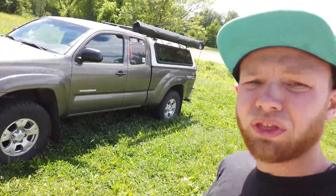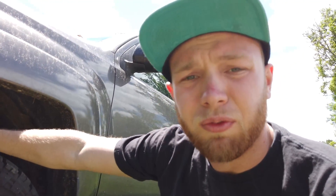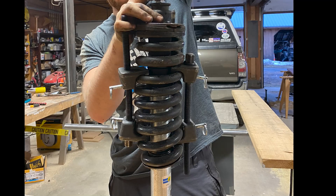I did a two and a half inch lift roughly, which looks fairly stock with 31-inch tires. I should be able to squeeze 33s on, and I think I'll do that when I need new tires. These are only two years old, so I should get another year out of them, and then maybe I'll do rims as well. Up front, I simply replaced the strut with a Bilstein 5100 — super common, adjustable — put all the way up to the two and a half inch lift mark. I rented some spring compressors to swap over the spring. I had less than 50,000 miles when I did this; I now have just over 52,000 and it's riding great — I think it improved the ride so much.